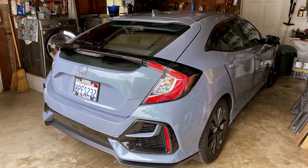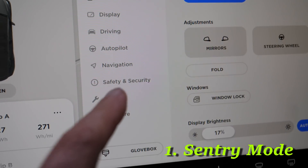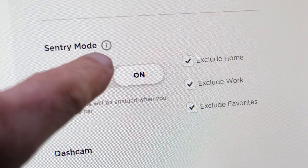So how often and how much do you really need to charge? A couple of things to consider: I don't like to completely drain the battery or charge it over 85%, so I'll be recharging after about 150 miles of in-town driving. Also, unlike my wife's Civic parked in the garage, the Tesla does use battery power just sitting in the driveway. My Tesla goes to sleep when not in use, but it never completely powers down. Three things can drain your battery while it's sitting. First is Sentry Mode — you can program it so it's not recording when you're at home, but it's still active and I've been losing about three miles of range every night parked at home. The best thing is to just turn it off.